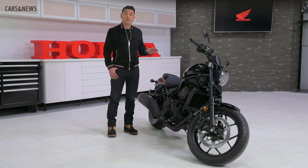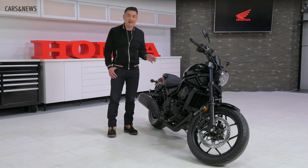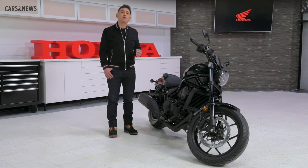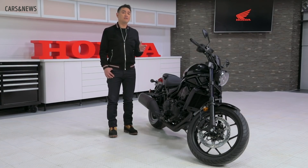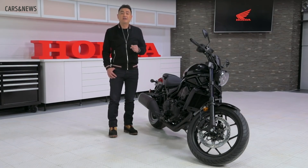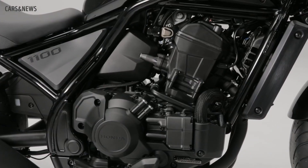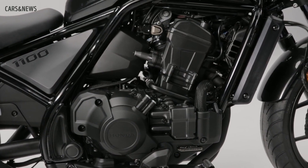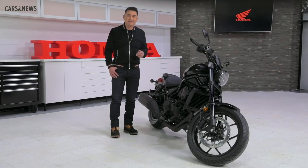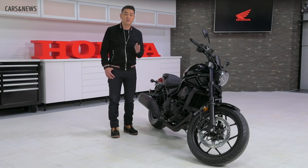The designers of this Rebel were challenged to lower the overall height of the engine, creating a lower center of gravity and a deeper bank angle. For those of you who are new to the sport, bank angle is basically the degree to which a bike can safely lean without tipping over. This makes turning easier — something that is often a criticism of large cruisers. They achieved this with a unicam valve train and dry sump, with the oil tank built into the crankcase to make the oil pan thinner. If you didn't understand that last part, just go back to thinking about those big sweeping turns.